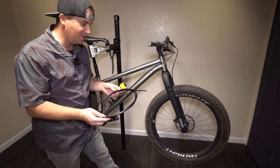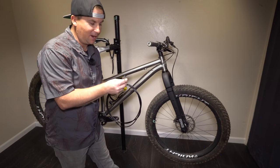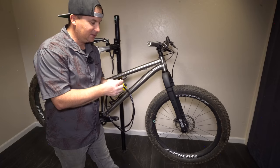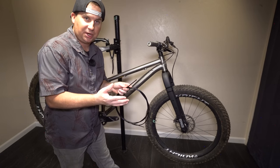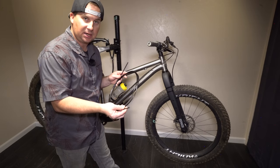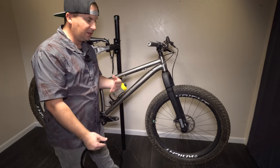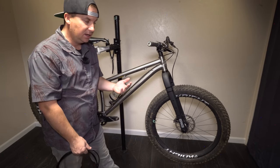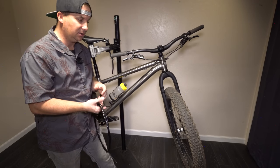For this install I had to go to my local bike shop, Thunder Mountain Bikes, and pick up some old school brake housing. I talked to the guys at Paul and they said it actually works better with the old school cheap stuff — you don't need to buy the compressionless housing. The fancy stuff is designed to work with it, but the standard housing actually works better. So unlike getting the best performance out of something like a BB7, you don't need to run compressionless housing with these.